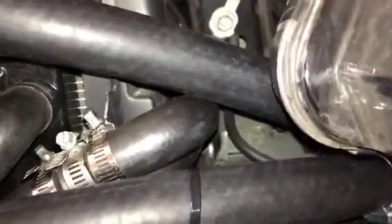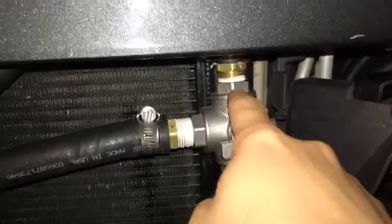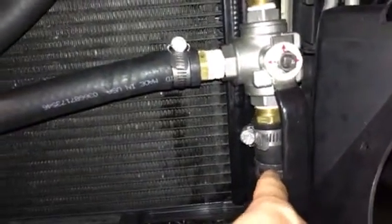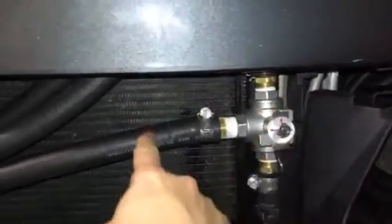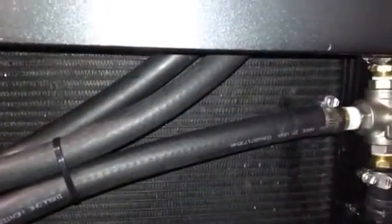You've got your hose running from the pump — this is the fluid direction from the pump — and you come down behind the crash support. This is where you plumb in the three-way. The end to the Edelbrock heat exchanger is at the base of the front mount, so you plumb in your three-way just before the end to the heat exchanger. Right now I have it bypassed, so it's going to divert the fluid this direction — this is my bypass hose, it's three-quarter inch hose.